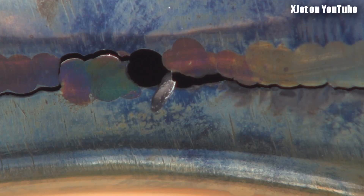So there you go - the fuel jet hole being too small was the problem. Both fuel assemblies I got - both the original and the replacement - had the same 0.9 millimeter hole, and it had to be one millimeter to make the engine run. But the quality is terrible. In my review on RC Model Reviews, I pointed out the terrible welding jobs that had been dressed up by grinding them down. They've ground it so much it's paper thin, so as soon as I got the engine running it blew a crack and blew bits out.